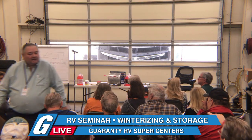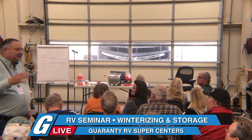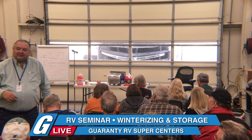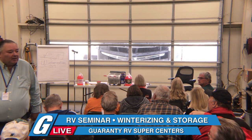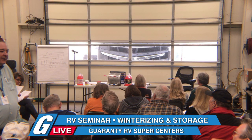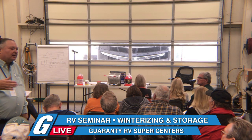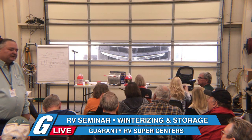Yes? If you mix that antifreeze with water, will it expand? Yes. That will not stop water from expanding. His question is, if you mix water with that antifreeze, will it stop the water from expanding? No, it will not. Water will naturally expand no matter what you put into it. Well, I was just thinking when you pour half a cup of it into a trap, it's going to combine with the water that's already in there, not push it out. In a perfect world, you may be right, but with the density of the two and the inertia, we have even taken them apart to see, and no, it'll just push it right through.